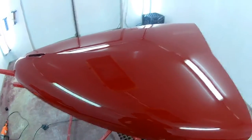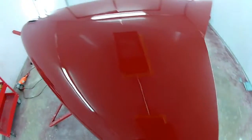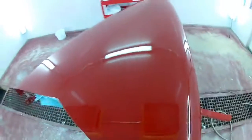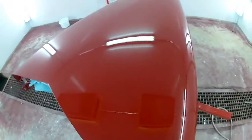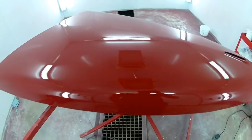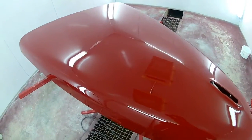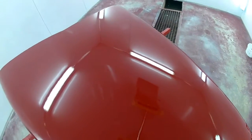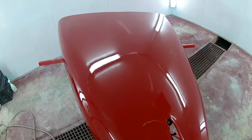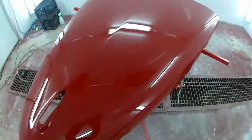And there's many ways to get to this point. There are faster ways. When you're doing panel beating, when you're doing factory style paint jobs, it's a whole different story. You want orange peel. It makes the job easier to blend in the future. It hides imperfection, it hides your blends. But when you do a custom paint job like this, you want that smoothness, you want that slickness. It needs to look like syrup. When you look at this reflection, that is absolutely what you want. And yeah, patience. That's what you need. So I look forward to showing you guys the rest of the car.